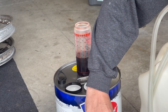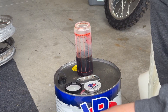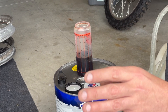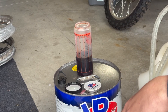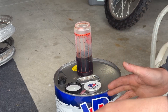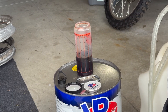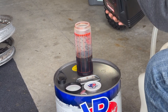There's a huge argument, and no matter when you talk about mixing two-stroke fuel, guys are going to start screaming. It doesn't matter who's right or who's wrong. What I'm talking about is: do you mix 32 to 1 or 40 to 1? This is basically the major argument. Some manufacturers call for 24 to 1 for a break-in period, some say 32 in the book. There's a lot of guys saying they run 40 so they don't foul plugs. I personally run 40 to 1 — that's what I have my bike set up for, and they run really good. Have I run 32 in the past? Sure. There's nothing wrong with 32, you just have to have it set up for your bike. Read what the manufacturer says and mix it to that. But for our purpose today, we're going to run 40 to 1.